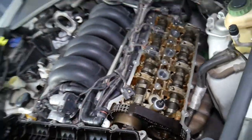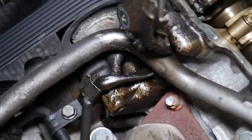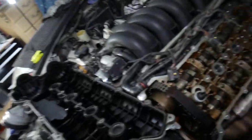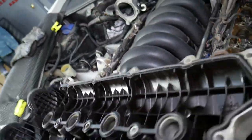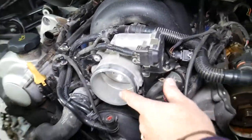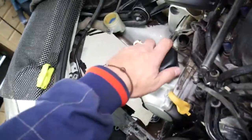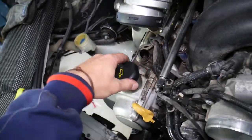If that device is bad and stuck closed, you will build up pressure that can lead to an enormous amount of oil leaks. If you suddenly develop oil leaks, like we see here, it could be because of a bad PCV valve. If it's stuck open, it will start pumping oil into the intake manifold — you may see increased carbon buildup in the intake, a dirty throttle body, and a sludgy film on the oil cap. That's also a sign of a failing PCV valve.